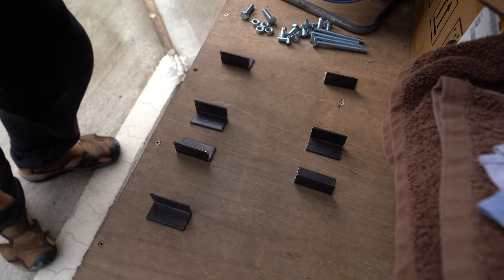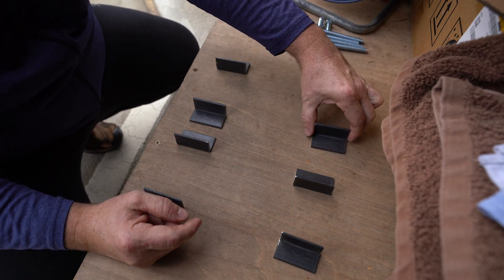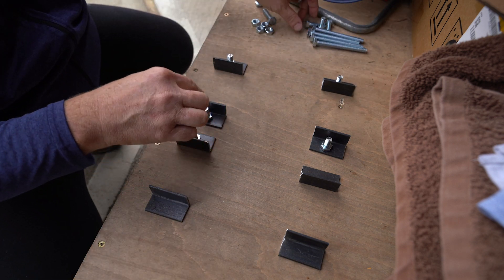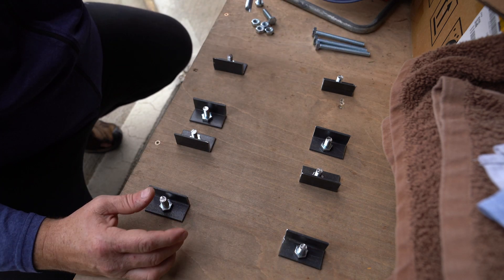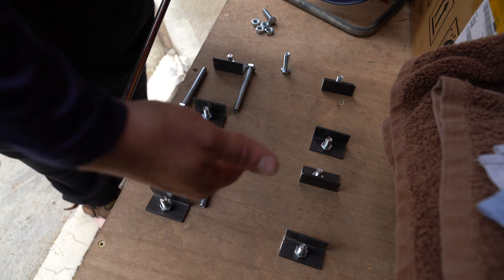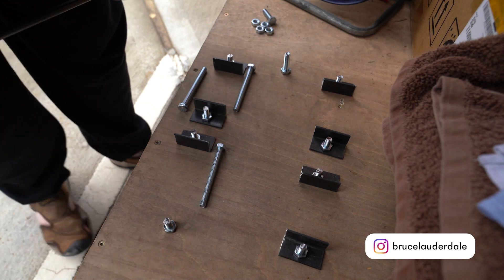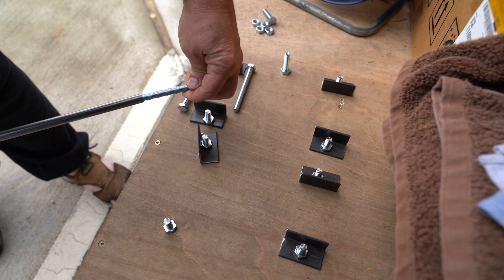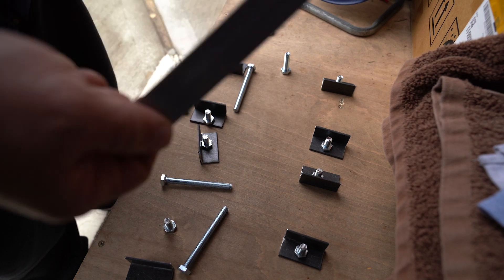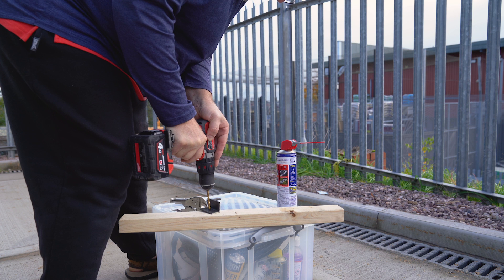Why the heck is there only 7? Because the 8th one is here. Imagine this is the van — front, rear. This will be on the roof racks I've put on. So the Unistrut — these bolts will go through into the Unistrut with a spring washer and some Loctite adhesive. These ones will go through this panel into the solar panel bar which runs all the way across. On the side of the solar panel I have these which will just strengthen the entire panel. So that's the theory.